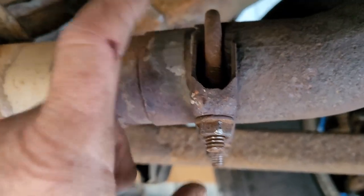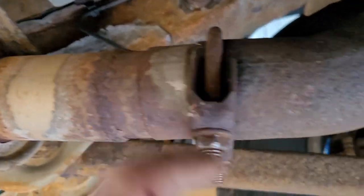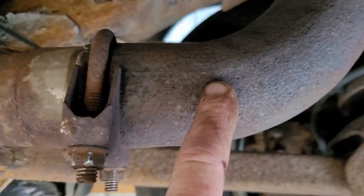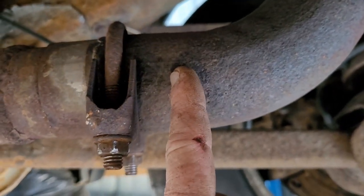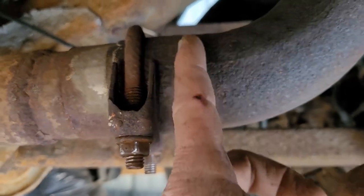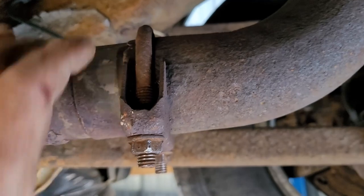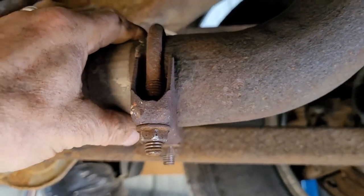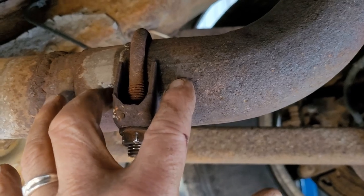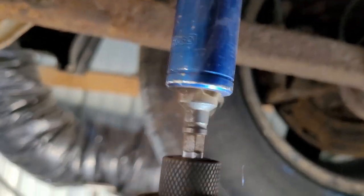This would be two and a quarter outer diameter, and this is technically a two and a quarter inner diameter. So what I did is I chopped that off — I need to chop that off anyway. I chopped it partially where they crimp it in between the two. I just pounded it in here and was able to get it two inches on here solid. And that should be it. I am done. That's the quick exhaust repair.